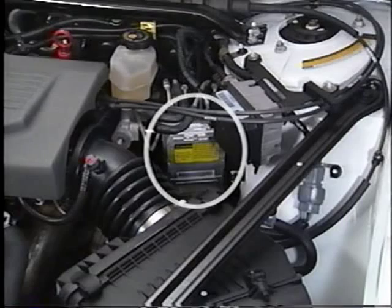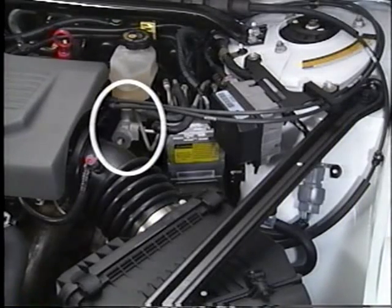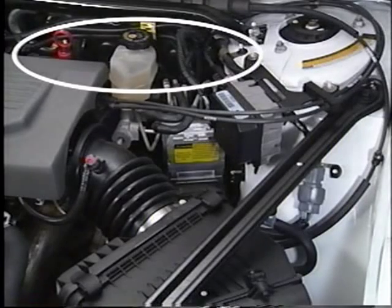Suppose the customer wants to know why the noise is happening. I tell them it's a hydraulic fluid vibration noise created by the ABS system. This box here is your ABS unit — it's got eight on-and-off solenoids, little valves that control your brake pressure to each wheel in an ABS stop. Every time these eight solenoids turn on and off, little shock waves go right up the fluid in these pipes to your master cylinder and start the vibration. Because it's bolted to the car, this area is affected and vibrates too. Inside a quiet car, this vibration is naturally louder, and that's what you're hearing. If they only hear it on ice and not on dry pavement, it's the ABS system working normally — it's actually telling you the anti-lock brake system is at work stopping the car. Out of all the total number of times you hit the brakes, only a handful involve ABS.